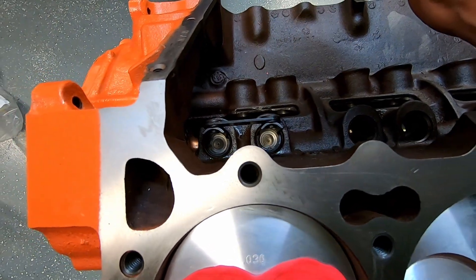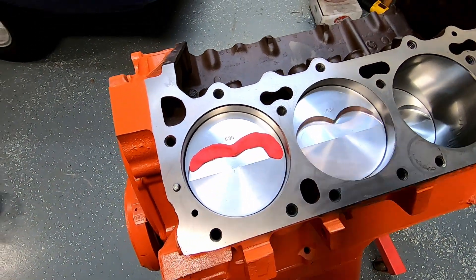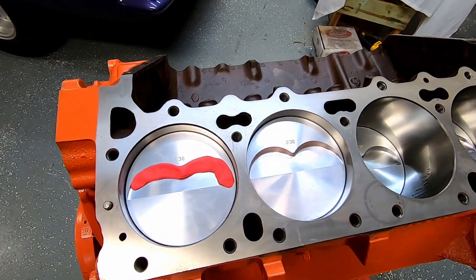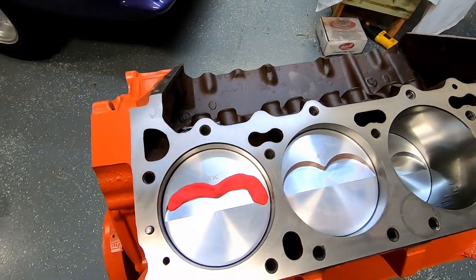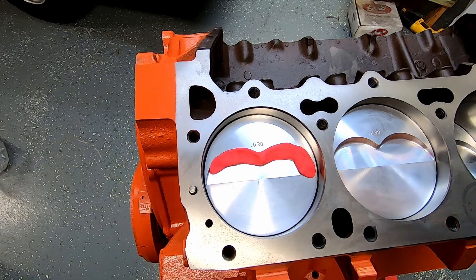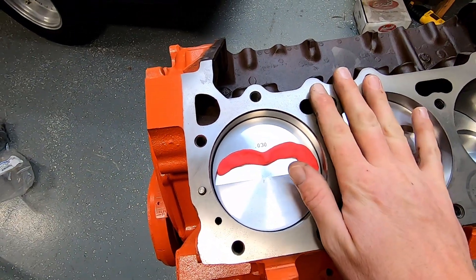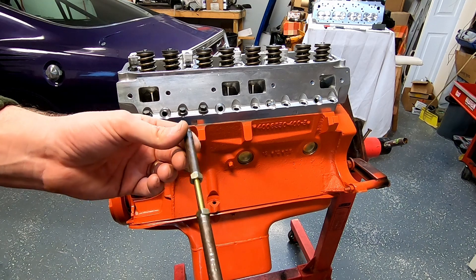I've got my Johnson high-lift solid roller lifter in, and I'm going to bolt it back up. I'll show you lash setting real quick, but I think I'm going to do it without a gasket right now, because I can always add the thickness of whatever gasket I'm going to use. I don't have a compressed gasket right now, so a throwaway gasket would be 50 thousandths and it'd still be kind of a guessing game. I think it's more accurate to go head bolted right down on the deck.